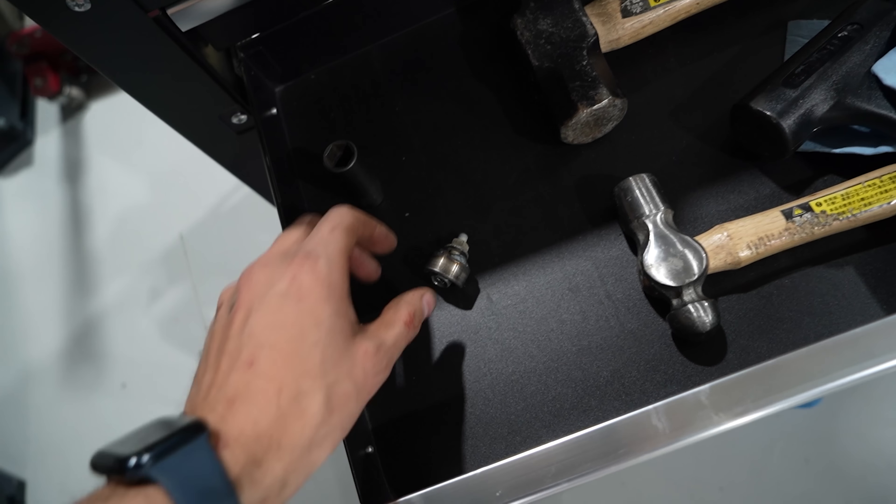Super simple - welded a washer in there that fit in there perfectly, welded her in all around the edges as best I could upside down, then smacked that thing out. Now as you can see we've got the manual pilot bush in there. The automatic one takes up all this space - it's always the hardest one to get out because you can't use the bread technique. The manual one has space behind it so you can cram bread in and push it out, but the automatic ones are flush, so they're very hard to get out. That's why I do it this way.